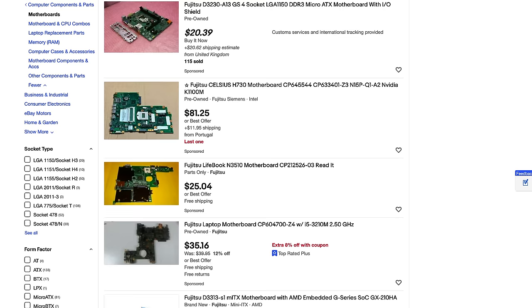If you're building a NAS, you're obviously going to need hard drives, and here you have a choice between 5400 RPM and 7200 RPM drives. The 7200 RPM drives are usually slightly faster, but also run louder and hotter and consume more power. Western Digital — who by the way sponsored this video — has both 5400 RPM and 7200 RPM CMR drives in their Red lineup: WD Red Plus and WD Red Pro. The WD Red Plus drives consume as little as 3W at idle, and when spun down, this number goes down to 0.4W. The 7200 RPM Red Pro drives, apart from being faster, can also be used in server enclosures with up to 24 hard drive bays, thanks to their anti-vibration technology. Both WD Red Plus and Pro are CMR drives no matter what capacity you go for, making them a great choice for a RAID or ZFS array.